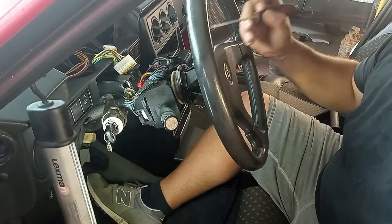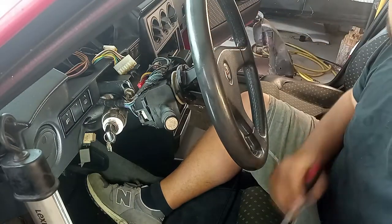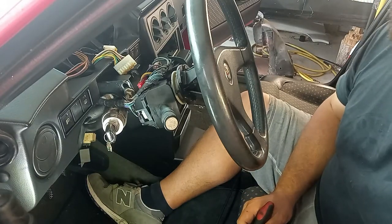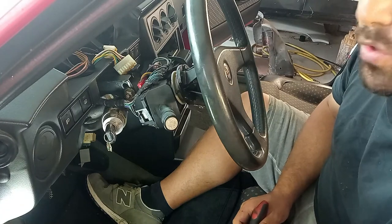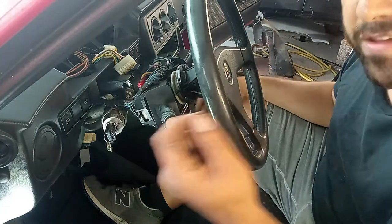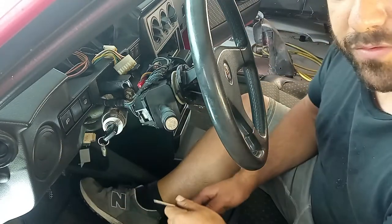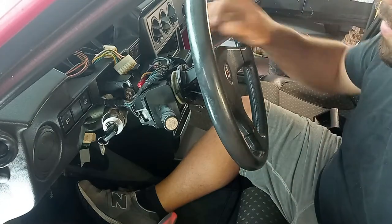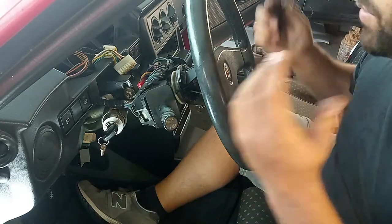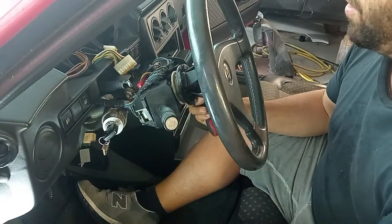So on the steering wheel for the Mito, you have very thin wires, just two connectors, and the wires are very thin. That is not because it is cheaper, it is because the wires just communicate digitally. These ones here are live 12 volts and live grounding, okay? So this needs to be very thick. For that we have a bunch of them, every one of them has a separate function, and obviously we have a lot of equipment here on the steering column.